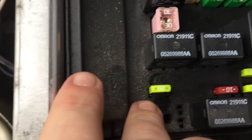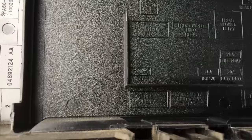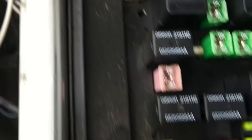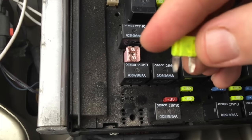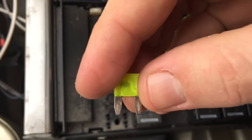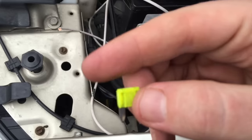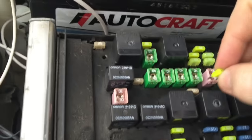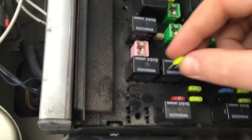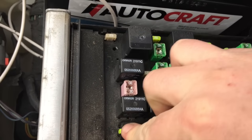Your IOD fuse is right here on the diagram — see, it's right there above the front wiper relay. I pulled this fuse out and what do I find? Turn it over — yeah, that kind of looks like a nice little solder knob in that fuse. So we've got ourselves a fresh new 20 amp ATM fuse to replace it with.